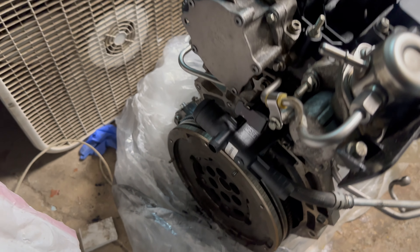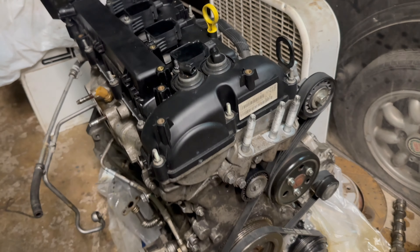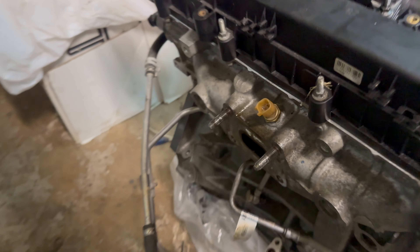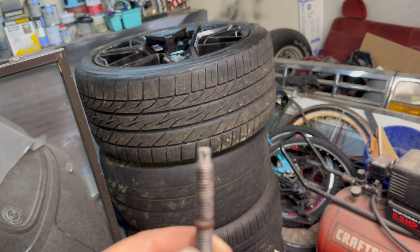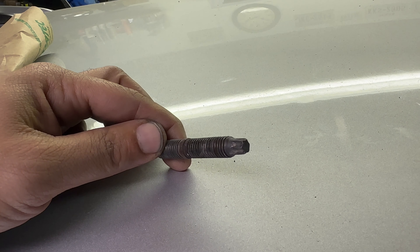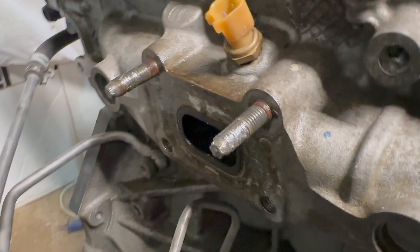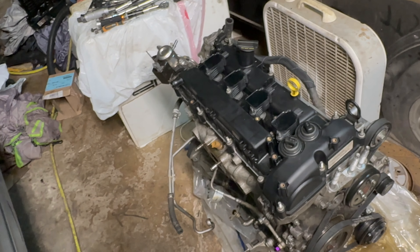Got pretty much everything back on the engine. We have the flywheel, all the accessories on the side minus the starter, and up front the belts are all on. Got all the spark plugs back inside and all the caps on. I was taking off these studs — they have like a star on the end; you guys can tell me in the comments what they're called. I do have the tool to take them off. Two of them came off, however these ones completely snapped and I tried to put the extractor on them and it just smoothed them out. So now we've got to get those two top studs out before we can finish this job.